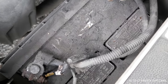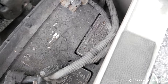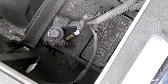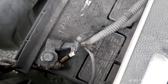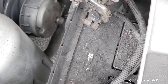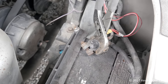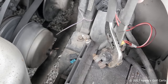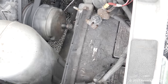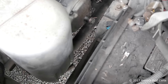I grab these wires — oh look at that, that's loose! See this one here is nice and tight, but this one's loose. This could be our problem. I'm going to twist it and squeeze it — okay, we got a click from the solenoid. Let's twist it again — there we go, there's our problem.